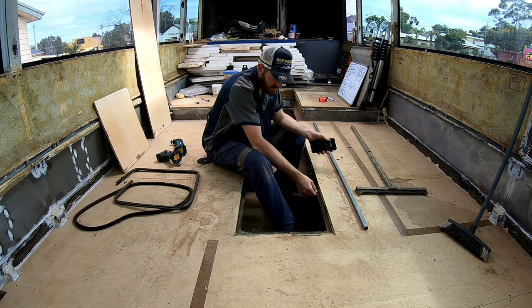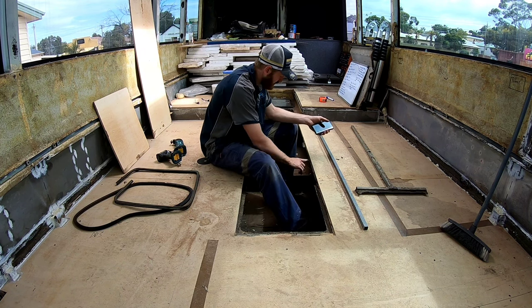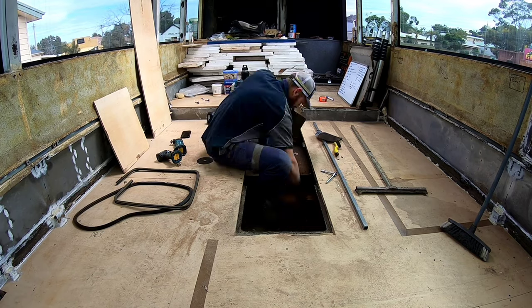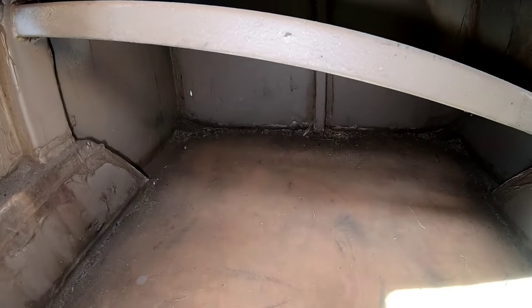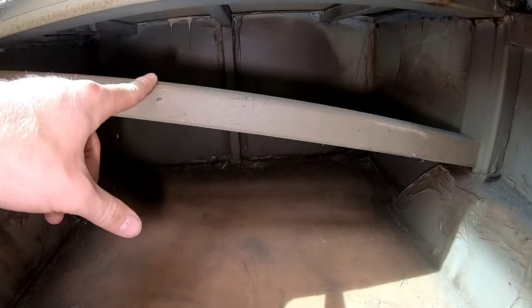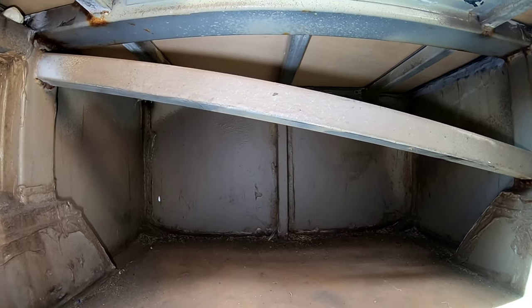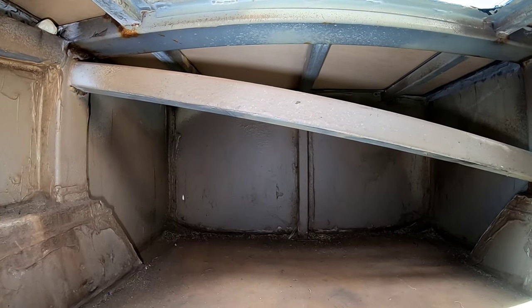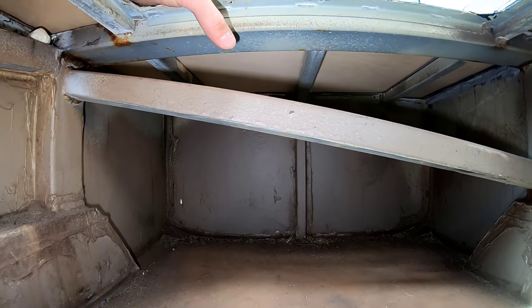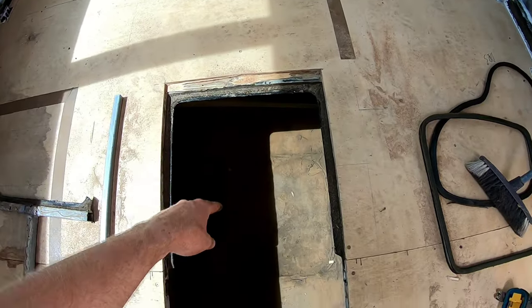So let's get a bit of storage. I was going to cut this little lip off but it might actually be good for the new door to sit down — I'll have to make one at the same height all the way along. This is the area — this part is part of the frame so I'm not going to cut that out, but back here it goes back a little ways. That's going to be for the shower base pretty much, so I'll make a really low section that comes down a fair way with a bilge pump and make a recirculating shower. It works out perfectly there — I didn't really plan it too much but I knew this space was here and it'd be good for that, because it's hard to access because of this bar. We'll use all the storage this side of that bar, and then this area will be part of the shower base right there.